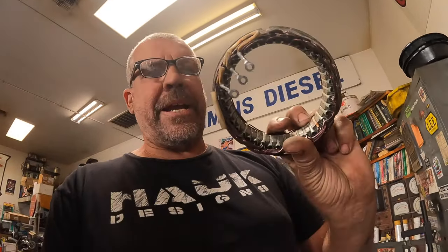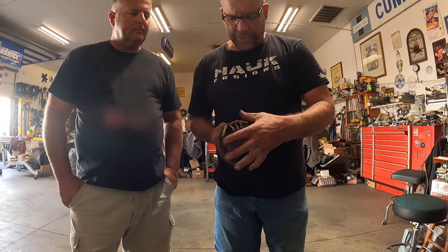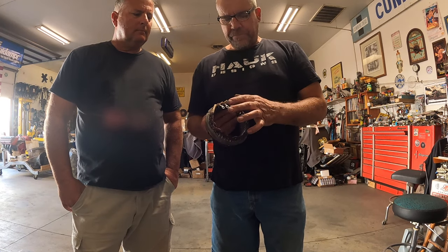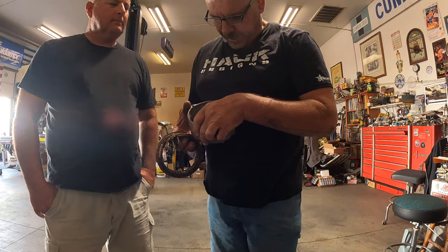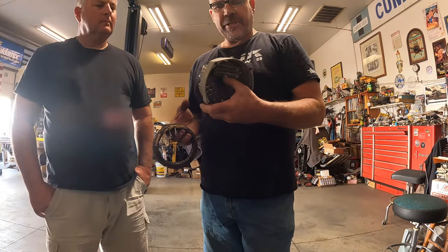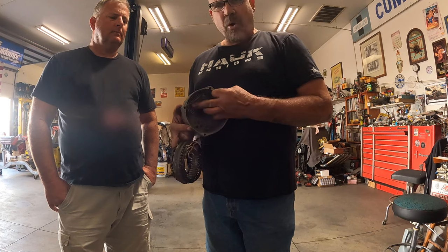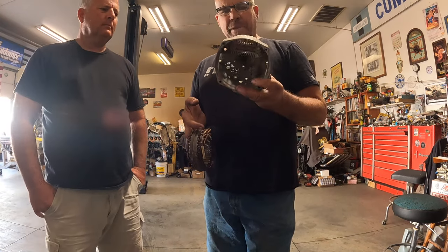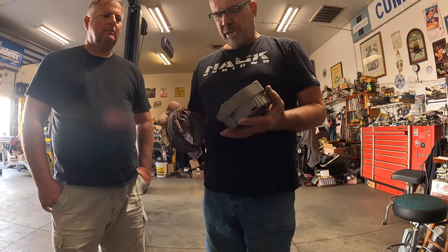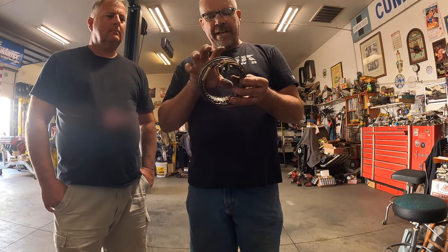The purpose of the rectifier is this coil. This coil right here has three windings in it, and these three windings are actually in series over the top of each other. What these actually do is create an AC current on each one of these legs. Each one of these legs is then inputted into the rectifier, and the rectifier converts the AC voltage to DC. Depending on what you're regulating at is what that voltage actually reads - it can read anywhere from 0.1 volt to 150 volts, depending on the RPM of the alternator and how much field control was being put in.